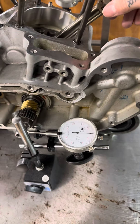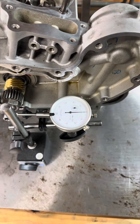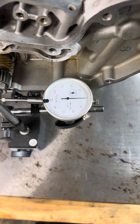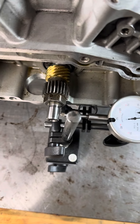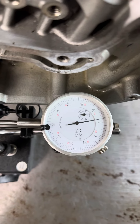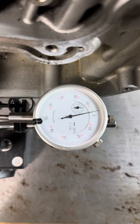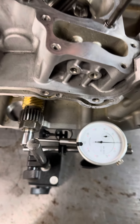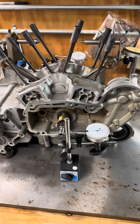I don't have a stand here to hold my phone so you're going to hear the connecting rod rubbing on the case a little, but it's still going to give an accurate reading. As you're rotating the connecting rods, the pinion shaft is spinning and you're getting your pinion shaft runout. Mine's just at about three thou, so I'm going to be pulling this crank out and truing it up — we may weld it, we'll see.